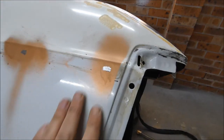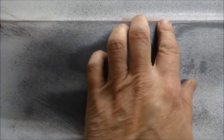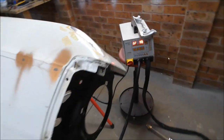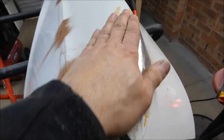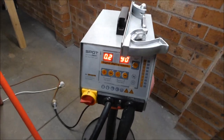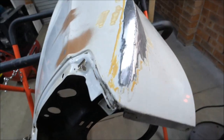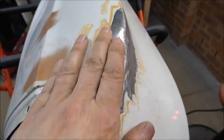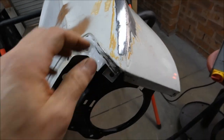I've just knocked down some of those plug welds I did earlier for the moulding holes that were there. They're all down low enough that I can't feel a lump. I'm working this area here which had the damage. I tend to try and panel beat as much as I can with the hammer and dolly to get areas down, and then with the Easy Beat — I love this little machine, well, it's a love-hate relationship sometimes. I am getting slowly better at it. I'll just yank out some of the dents. They're a little hard to do from the back because you can't hold a dolly on this side, so the Easy Beat makes it easy in that sense.